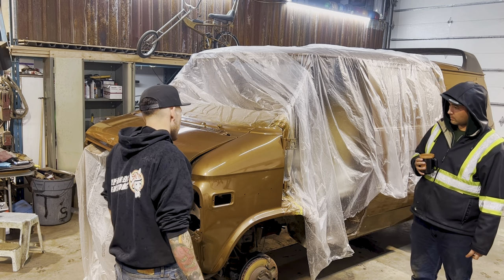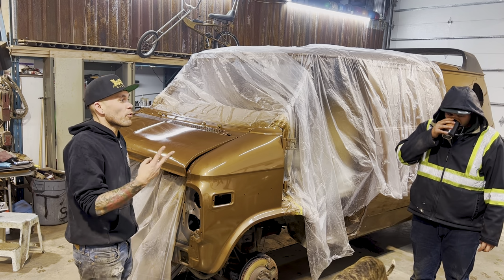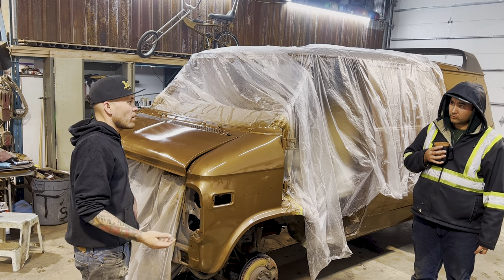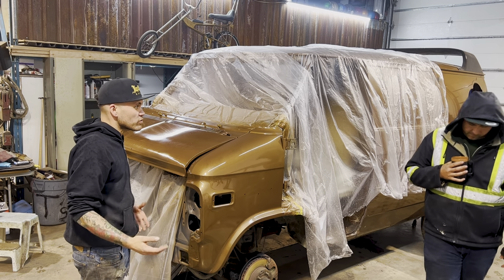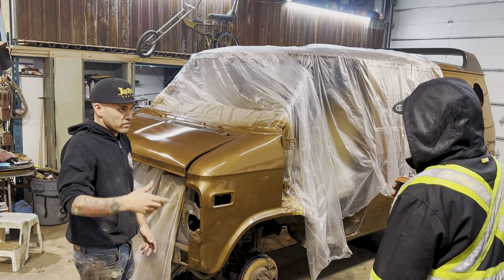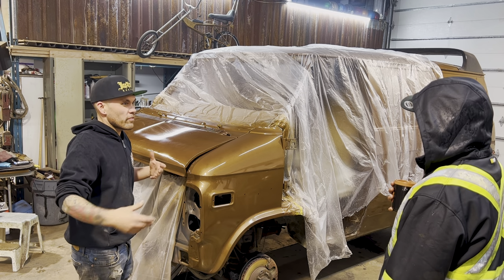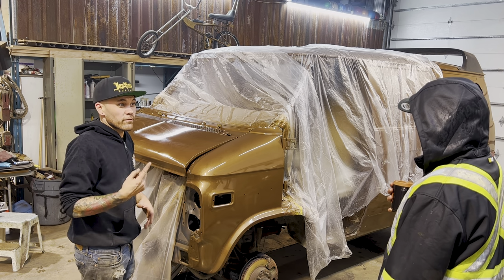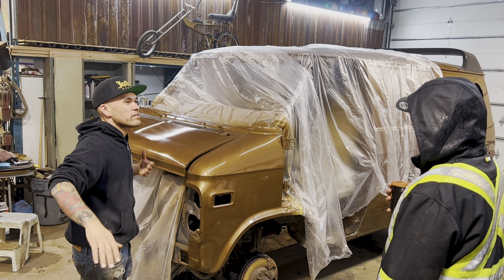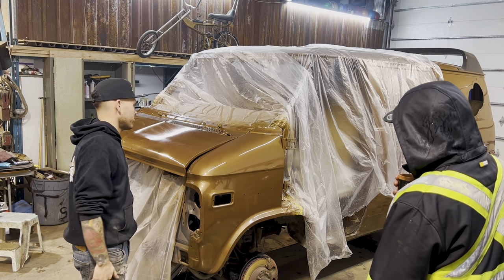So I'm happy with it, honestly. Me too. If I had two more cans of paint, I would have tried one more final coat of full wetness. Usually when we do a metallic paint, like I see Charlie do it, you do one really light one to help it stick, another that's the first layer of full coverage, and then one final that wets everything out. Best case scenario, I think three, but I think it looks good.